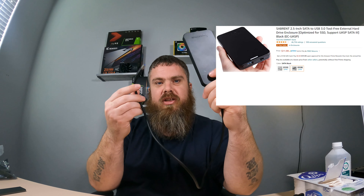The next tool is really cool — it's what I use to flash Hive OS onto my 2.5-inch SATA SSDs. This is a SATA SSD to USB 3.0 adapter. I don't have to tear apart my computer or leave the back open. I just plug this into USB 3.0, flash it, and it's that easy. This thing was like maybe $20 — really cheap, easy, and fast. I like things that make my life easier.